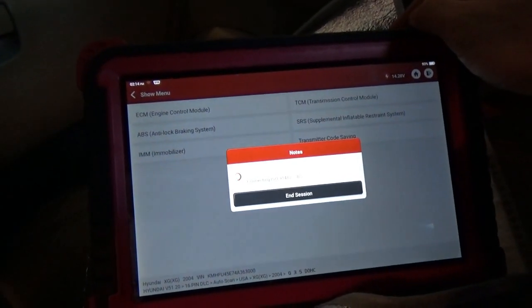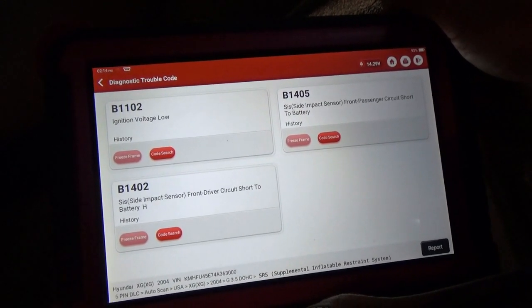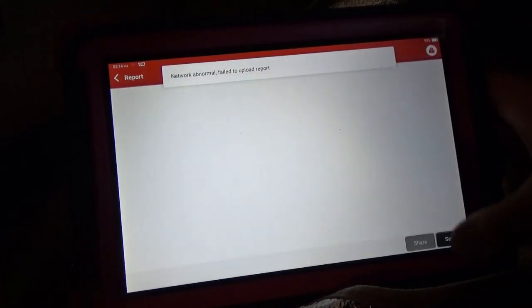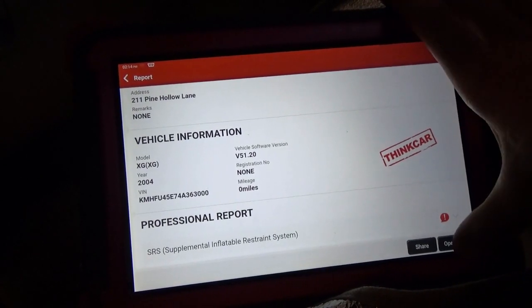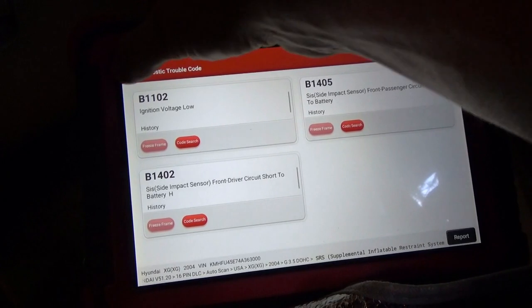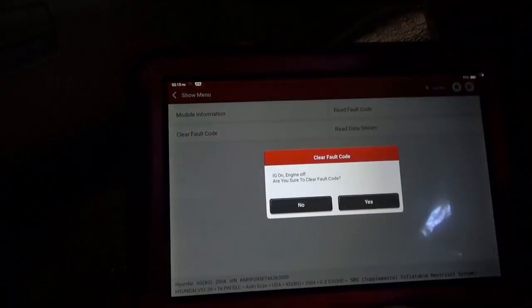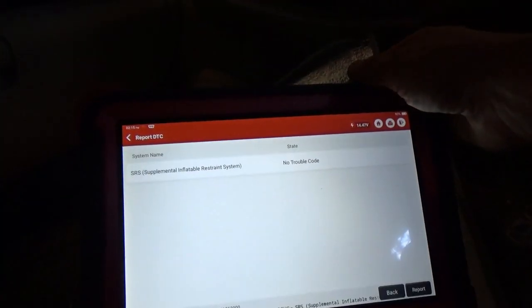A little bonus footage — the airbag warning light is on. Let's see what that's all about. Read fault code: side impact sensor front passenger circuit short to battery. They're all history codes, so we can save those. Ignition voltage low. Side impact sensor front passenger circuit short to battery. Front driver circuit short to battery. Let's just clear that out. But the customer said it's been on — has that airbag light been on for a long time, Don? It's been on for years. Well, let's see what happens if we clear it out. It's still there, but there's no trouble code. Let's cycle the key.